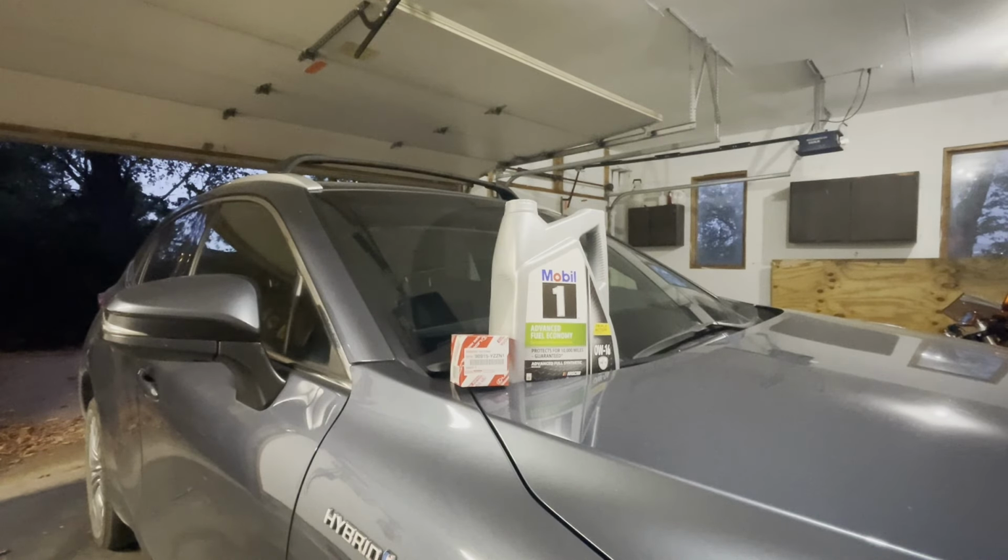Today, I want to change the oil on a 2021 Toyota Venza or Toyota RAV4. What you'll need to do this is 5 quarts of 0W16 motor oil and also a brand new oil filter. There'll be a link for both of these in the description below from Amazon.